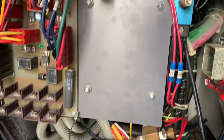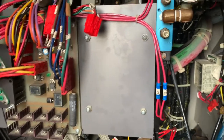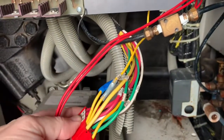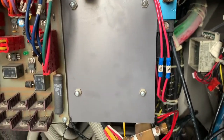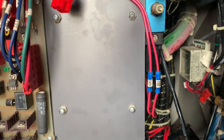There's a connector, a couple hanging connectors. And I guess I probably thought that was some option when I was looking on the bus, didn't realize it was important, but nonetheless, that is where that relay is supposed to be. And you'll see in this group of wires, I found the white ignition wire. So I need to build a board and put a relay on it to at least get that problem fixed.